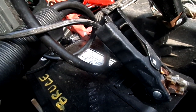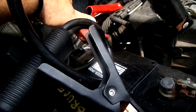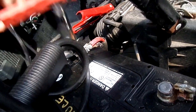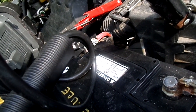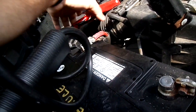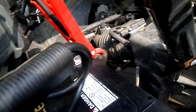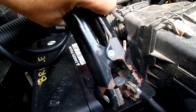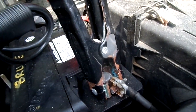If you're going to hook these things up, the black one comes off first always and the red one comes off second. Before we check anything, because the battery has fumes in it, it's always better to hook the positive up first. Remember: stop and go red — that's how I was taught. You don't really see much of any spark because you go red first, then black.